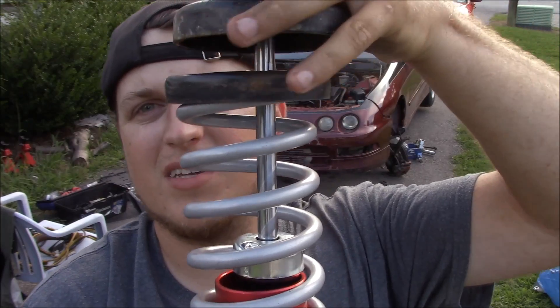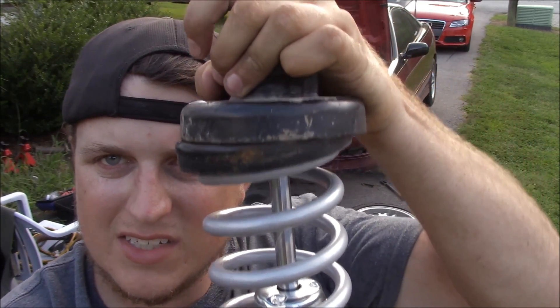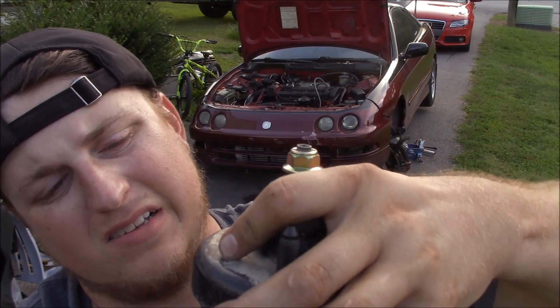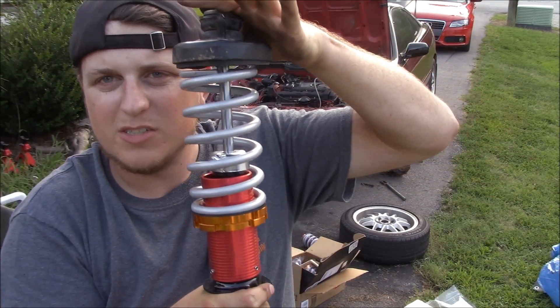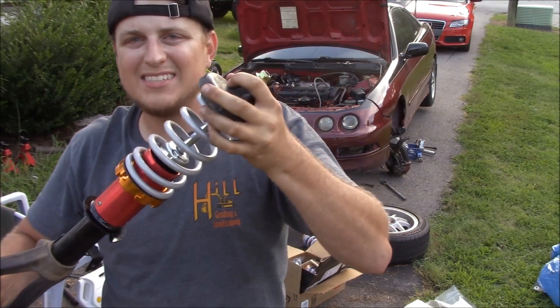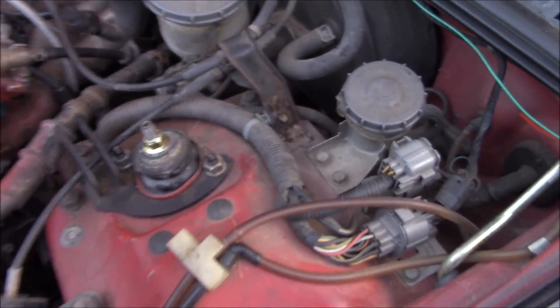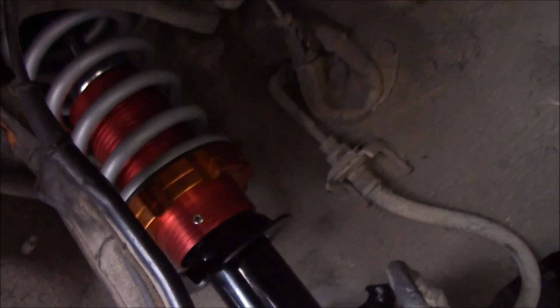Mine's pretty close. I set it to where I think it'll be a good height — it's got about that much piston showing and then it's like two inches down, and it actually touches the spring. That is the budget suspension right there. Pretty much all bolted up. It's glorious. Pretty simple. I'm going to throw the wheel on — first I need to tighten the axle bolt down. I'm going to get the girlfriend to come out here and hold the brake. I have about that much space on this side and I'm going to see how that looks so I can set up for the other side.